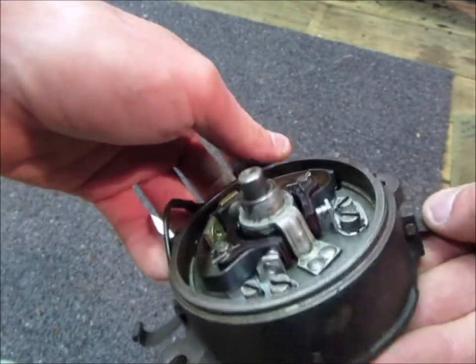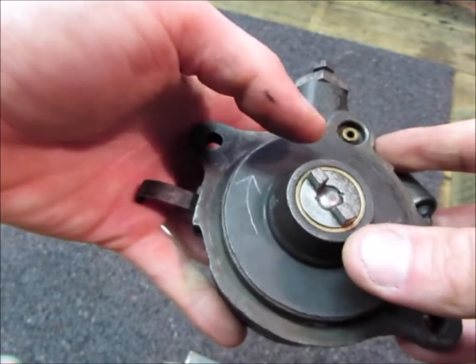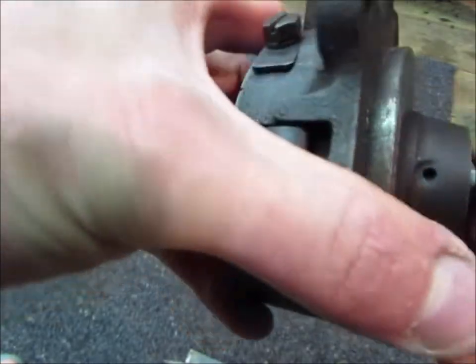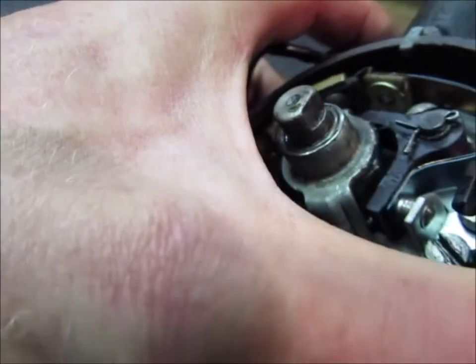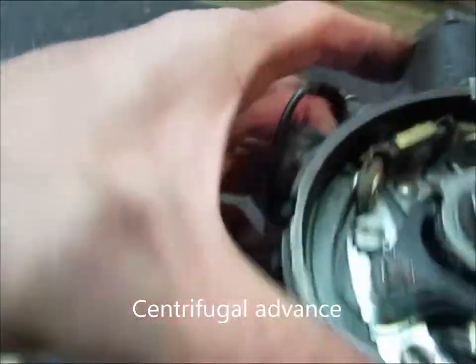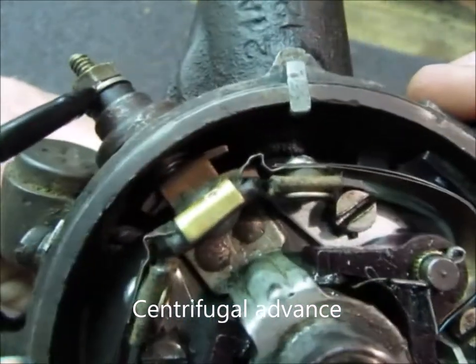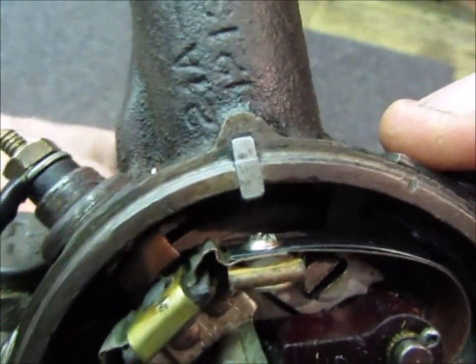If after all that you still can't get the correct timing, you've got backlash and you've got to back it off and then bring it up again. Because of the backlash and the vacuum brake — you can see there's like nearly a quarter of an inch of backlash.